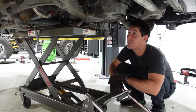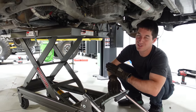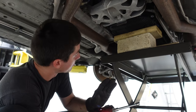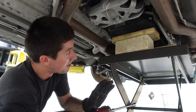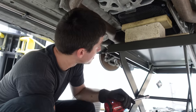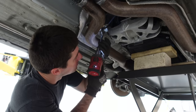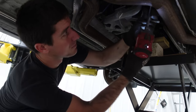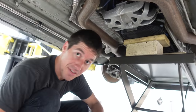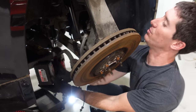We're going to lower it just a hair, and as we lower it or lift the car off, we'll start figuring out what's still hooked up — which, as far as I can tell, is just those two hoses. We have the transmission supported and the subframe supported, so the Harbor Freight jack is holding up everything. We're going to pull the rear transmission mount off — just four 13s — then move to the front and start pulling the subframe bolts. The transmission is definitely free; it just dropped down.